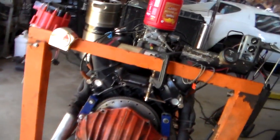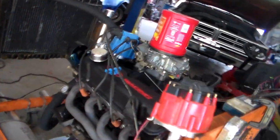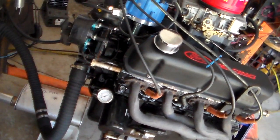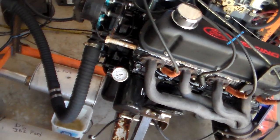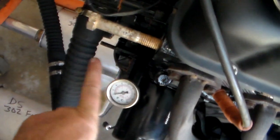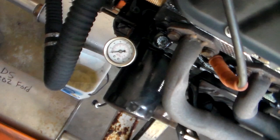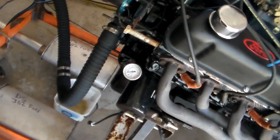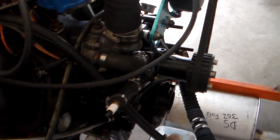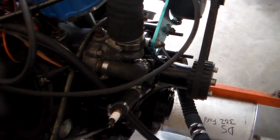Building it for Isabelle's Humpty Dumpty. We'll come back in a little bit and fire it off — hopefully everything sounds good. It was actually running good except for the lifter clacking real bad. You could literally see on the oil pressure gauge when it got to that lifter — the gauge was just pulsing. It still had 60 pounds but you could see it pulsing real hard.